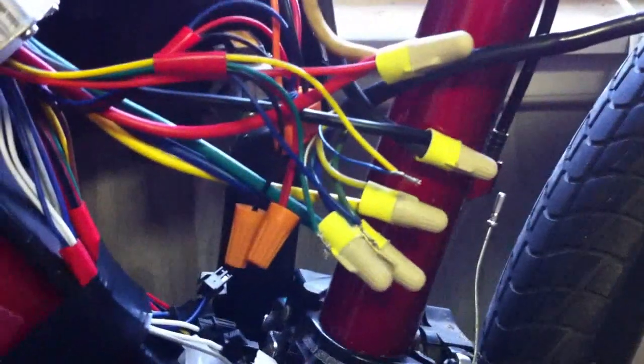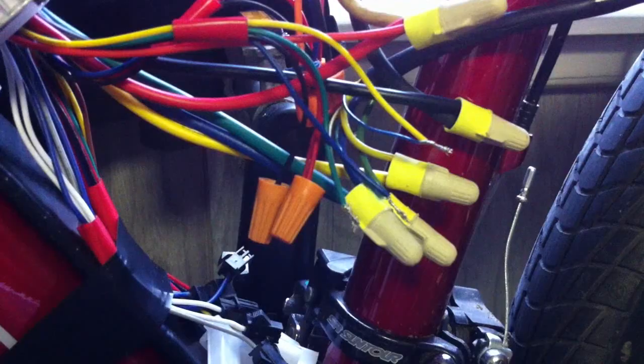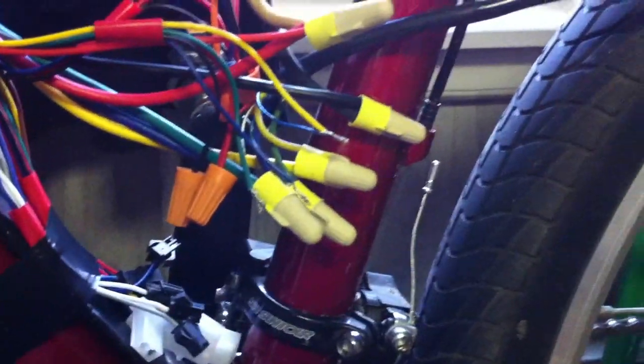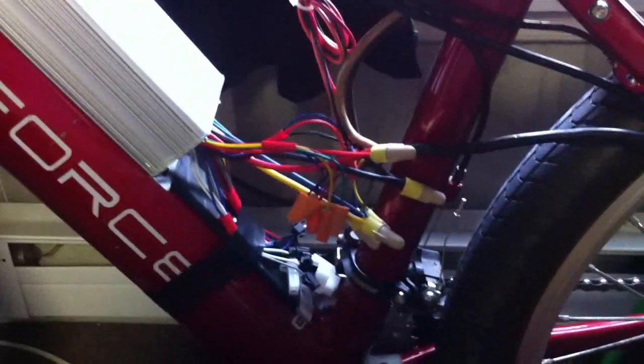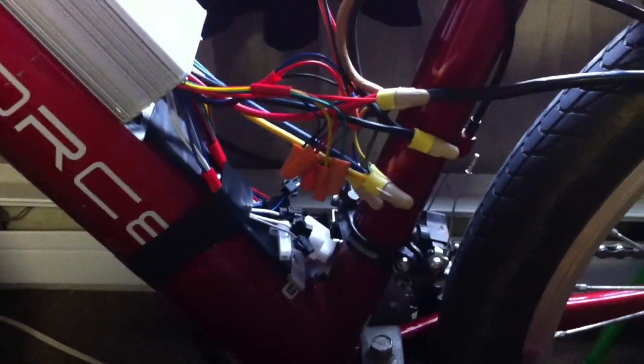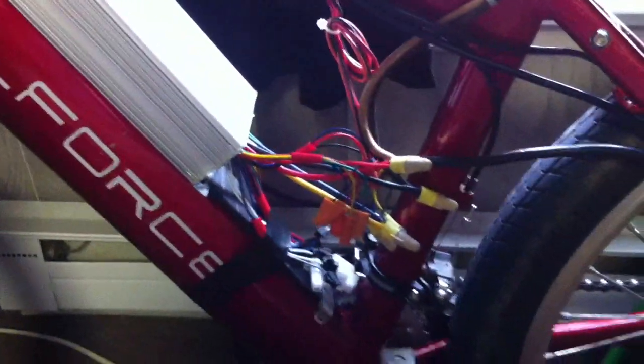With this combination every color on my hall is different, and it actually spins and doesn't make a groaning noise, but it spins backwards. My pedal just hit me in the shin and it hurt really bad. So now I'm thinking I have my halls correct. I've tried like every combination and I'm starting to give up hope here. The only thing I can do is make it spin backwards — I can't get it to spin forward. I wonder if there's a reverse feature on this controller. I guess I'm going to have to do some research.